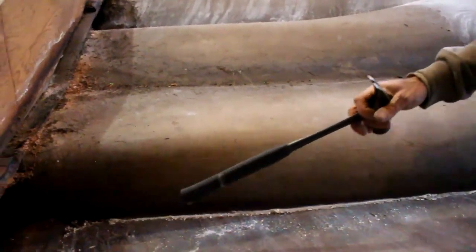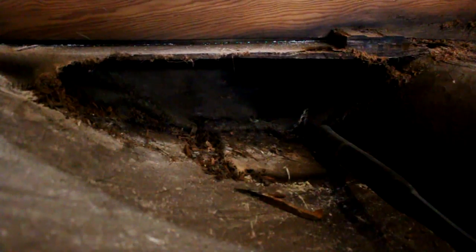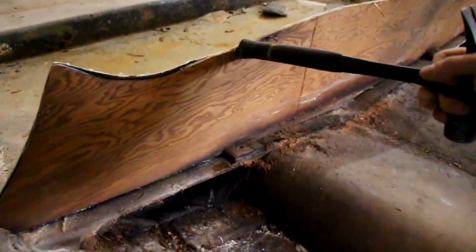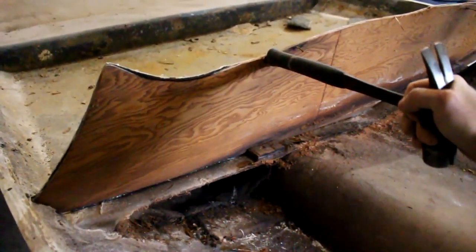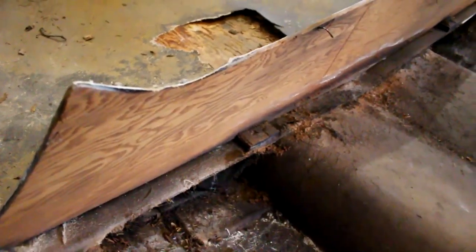Now, up here, we come into what in the actual... What is this? This isn't good fiberglass work. They really put these things out in a hurry. I wonder if that was a whole layer that was supposed to go through this boat. I don't know what in the world that's all about, but that's not good. This piece is tabbed in. Probably we'll use half inch instead of this quarter inch. Get that a little better.